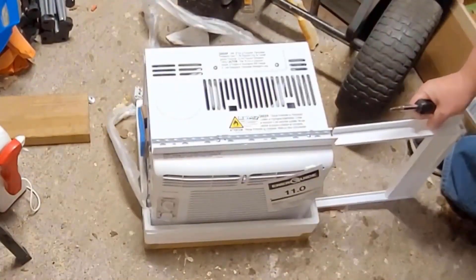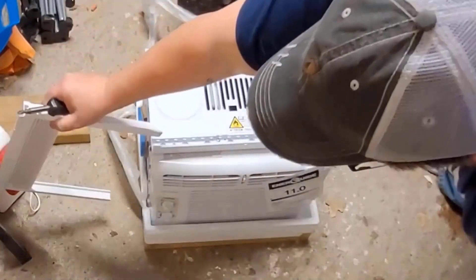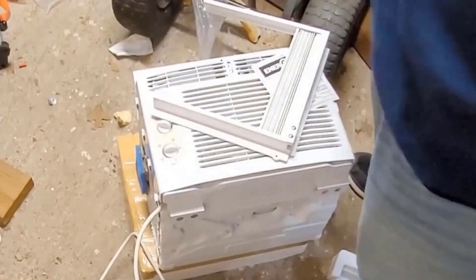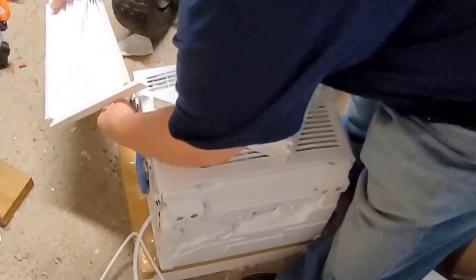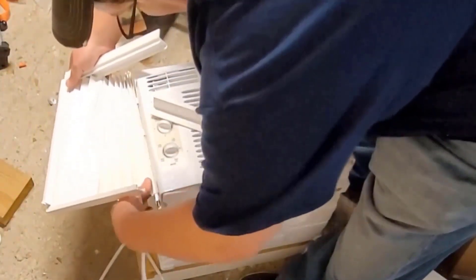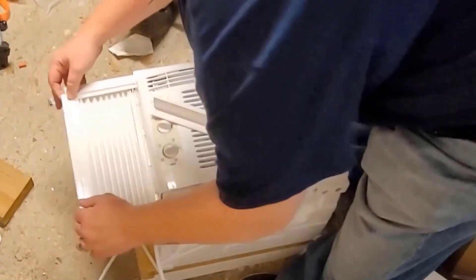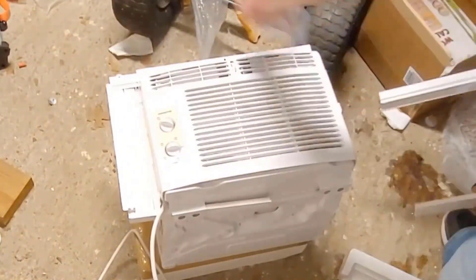This piece also acts as a guide for the accordion. Once you pull it out of the box these accordion pieces are gonna go the wrong way — it goes inside there, so that's how you get that going. Now I need to install the accordion pieces. I've got it laying on the styrofoam. You take these loose, grab the end, and just slide it through the side, then get it back into the grooves. This will go in the bottom, line up on top, push it all the way in, then do the same on the right side.